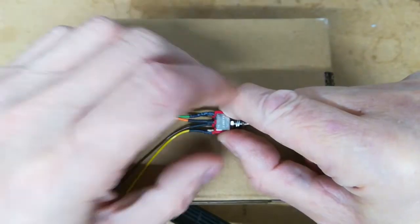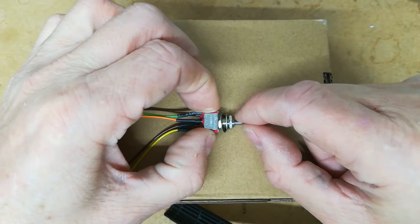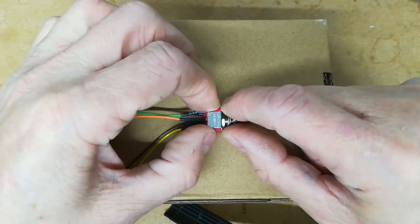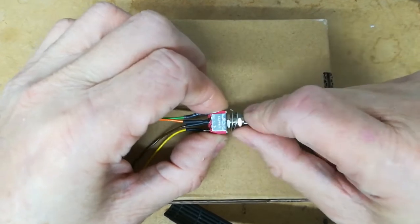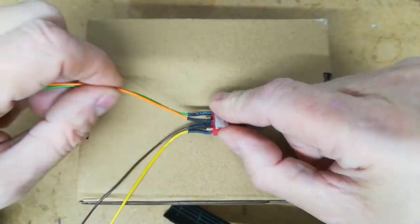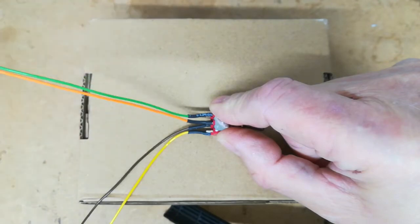But what we want to do is protect the battery possibly from too high levels of assist, or we might not want it to assist at certain times, even though you're in gear and the car is actually driving along and the engine's loaded. So what you would do is flick this into the down position here. That's the locking position, and that joins these two wires together. The clutch circuit is a 5-volt circuit, and again, it just joins these two wires together and connects 5 volts to the ECM.